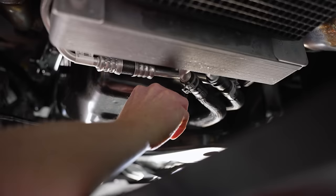Believe it or not, the Ford Workshop Manual actually tells you not to lubricate that O-ring because it would skew torque specs. Ford recommends 144 inch-pounds and then 180 degrees of rotation. I just take a thin film of fresh engine oil and lubricate the O-ring. Every oil filter I've ever done — aside from particularities like GT350 and GT350R flat-plane crank stuff where torque spec is fairly crucial due to engine harmonics — I just run them down hand tight, go a little bit more, and I have never ever had an issue.